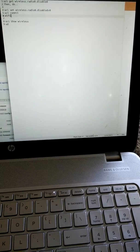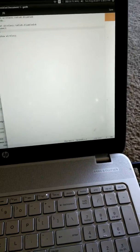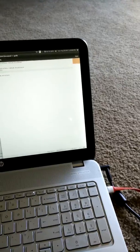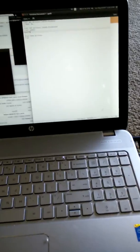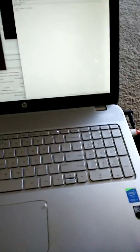And now the task for us is to convert our open network into a password protected network. So wireless security standards currently say that WPA-PSK2 is the secure and recommended option for home users, which you would be using by default if you were using this router or any router with password protection earlier. Don't go with WEP or WPA. We're just doing WPA2-PSK.